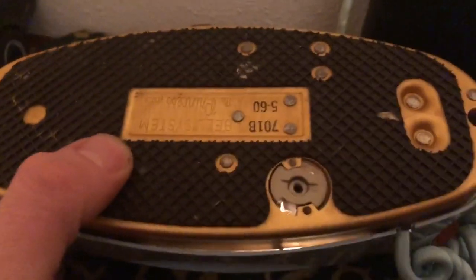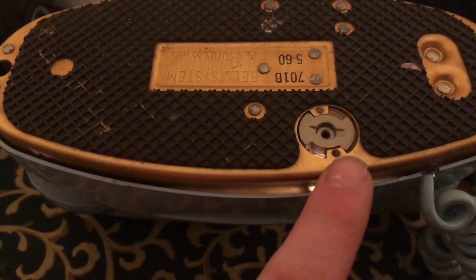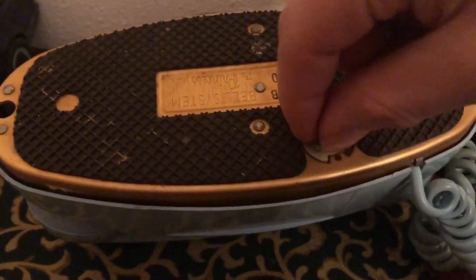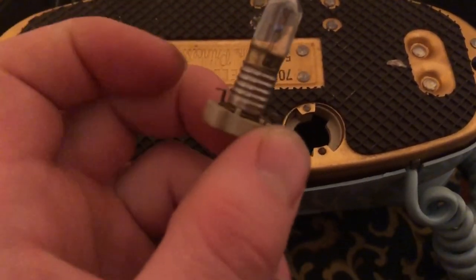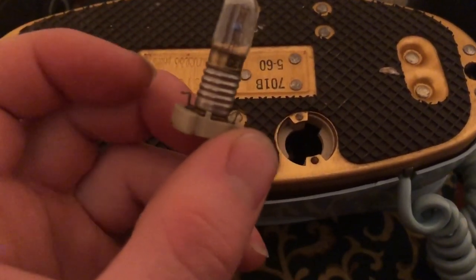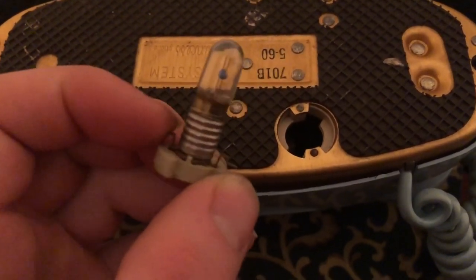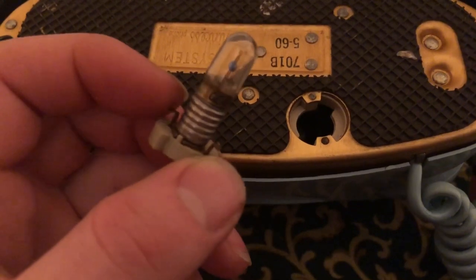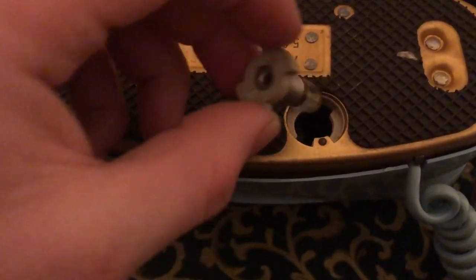You can go ahead and turn your phone over if you're having problems with the light bulb intermittently coming on and you know the filament is good — you might want to try the contacts. The little bayonet contacts on these are little copper wings that scrape the contacts on the inside of the phone. Mine I actually bent them down a bit because they weren't making good contact, and the metals can get corroded over time. You can also apply a bit of vaseline, cleaning oil, or rubbing alcohol to the metal to give it a good surface to make contact with.